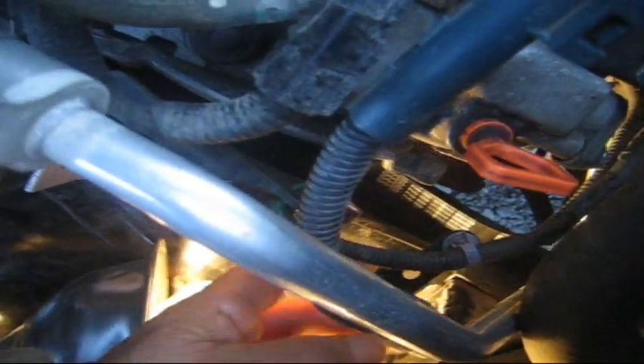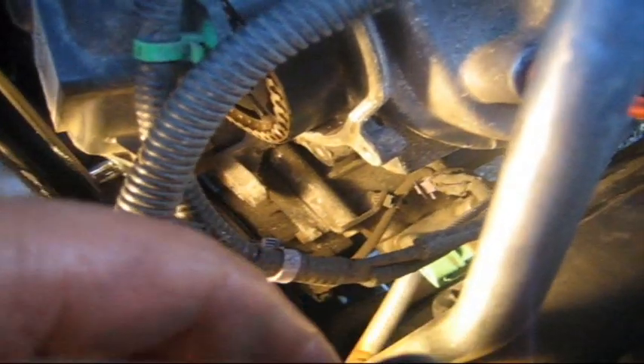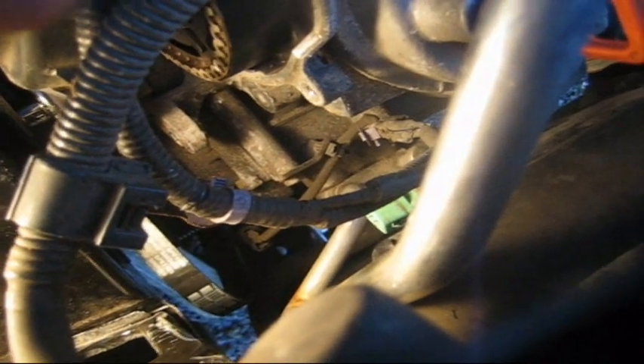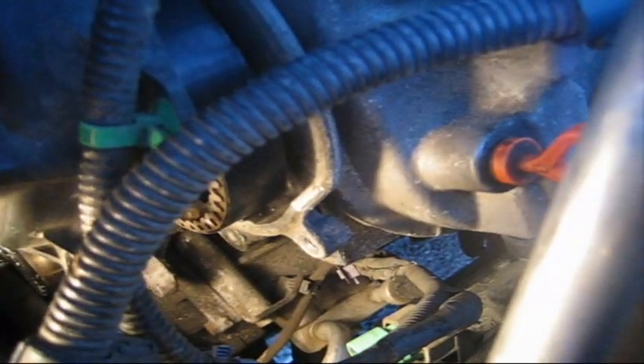I just want to point out a few quick things. There's not much wiggle room in here at all. And these rubber boots — there's one down here and the one that goes on the top of the alternator, which gets held down with a nut. These were very difficult to get off. This is probably the original alternator — this is a 2006 car, it's now 2018, so it was on for 12 years. What I used was a hose clamp — I was able to get under the rubber and just pry it. Some of these cars, depending on the engine, you might not have to jack the engine up or take this plate off. This is the first Vue I've worked on.